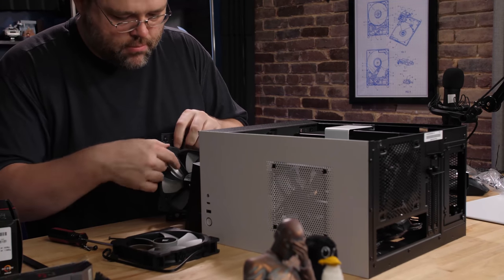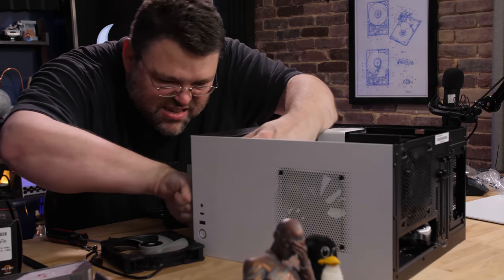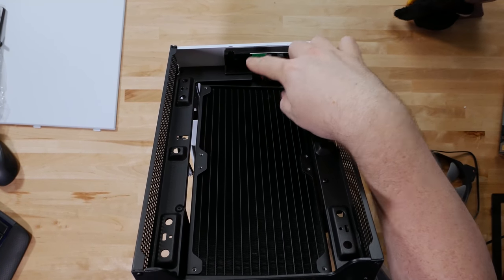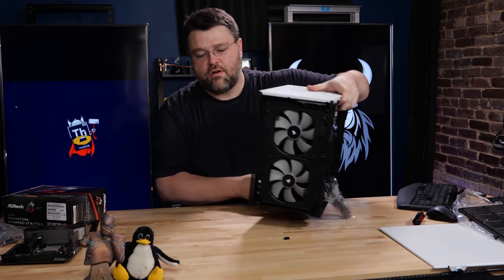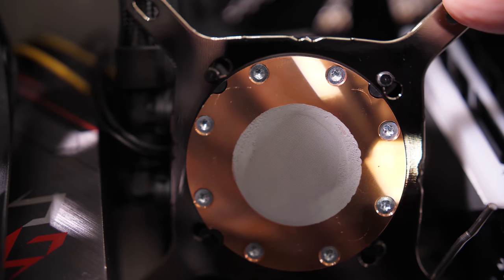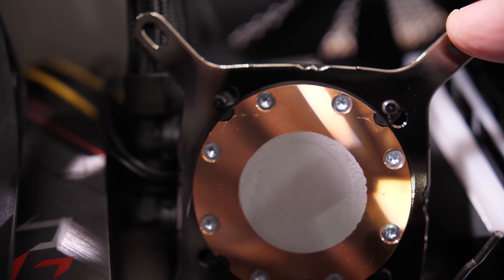My punishment for trying to use the Corsair 280 millimeter in an NZXT case — it doesn't fit. Well, it does fit, but you have to install it in place; it just barely fits. The H115i Pro is a little chunky on either end. The cables in the front make it a little problematic in terms of the radiator clearing the cables — it's a very, very tight fit. The Corsair 280 millimeter H115i Pro does fit; you just have to assemble it in place. You can see where the thermal paste has been mashed down around the circular edges of the cold plate, but the CPU is so concave that the thermal paste maintained its texture on the inside of the ring, meaning the inside of the cold plate was not actually making contact with the CPU — which is bad from a thermal standpoint.